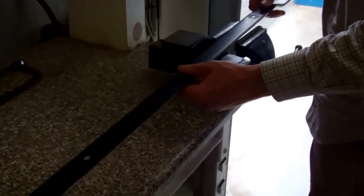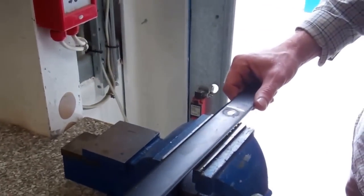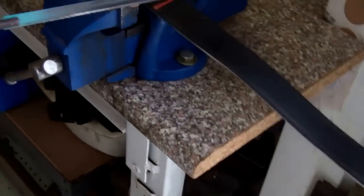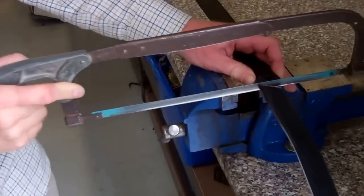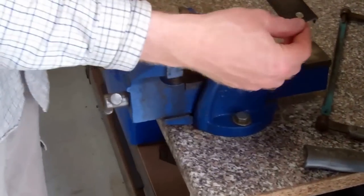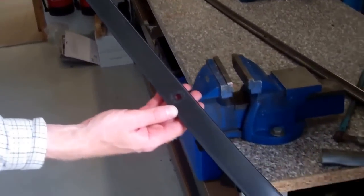What we're going to do — flip it over. We're just going to clamp that gently in the vice so it doesn't clamp on the rubber top, but on the aluminium bits on the side. Then we're just using a hacksaw. So now we've cut it — this bit we throw away, the bit we need is the short bit. We'll go on to the next step now.